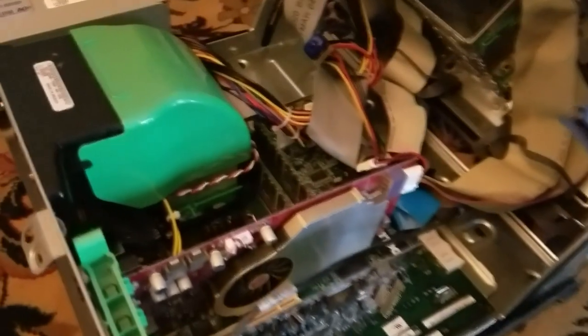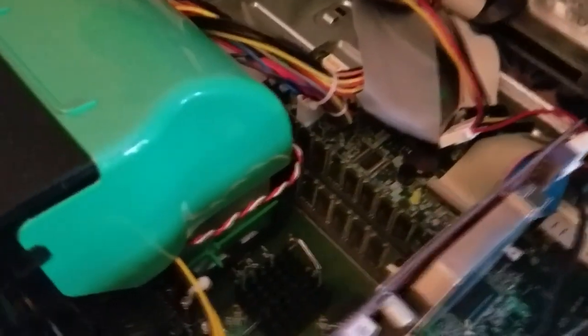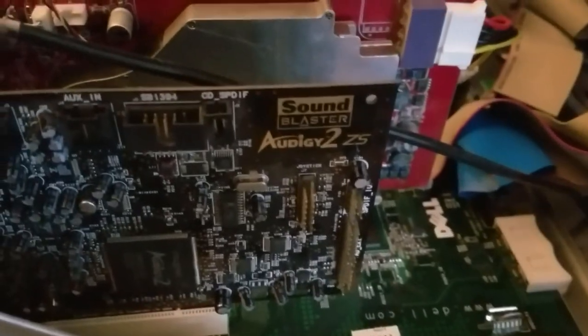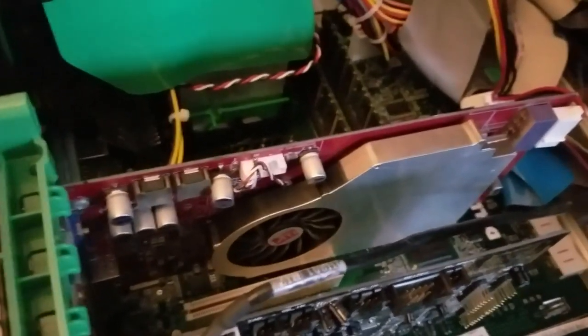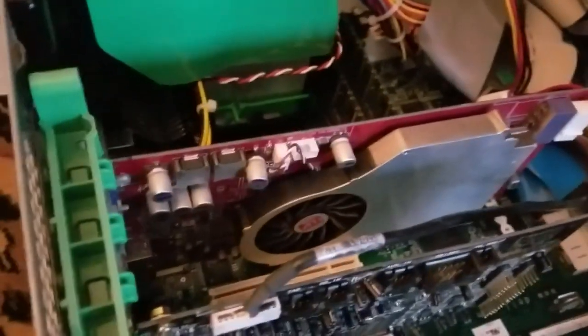This is my Windows XP computer, a Dell Optiplex GX270. We have a Pentium 4 running at 2.8GHz. The RAM is one gigabyte of original DDR memory. We also have the Sound Blaster Audigy 2ZS, a wonderful sound card with EAX support. And there's the main star of the show — that's the Radeon X800XL, slightly different from the X800 Pros I was talking about earlier, but this is the one I have in my system.